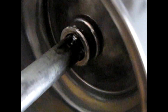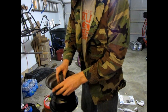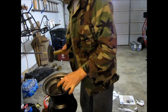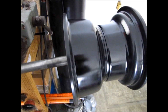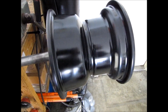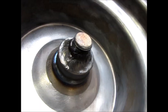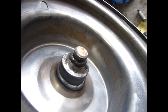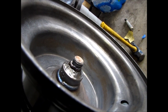This is after I got the rim on — I did it on the other side too. After I got everything lined up, I got the rim, just beat it on there and put it back on. Look at that — it's perfect. It took a long time, but there's the final result after it's all the way TIG welded all around. It's a permanent fixture on the axle because the axle was toast and the rim was toast unless I did this.